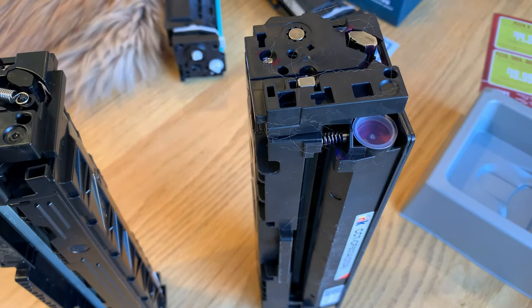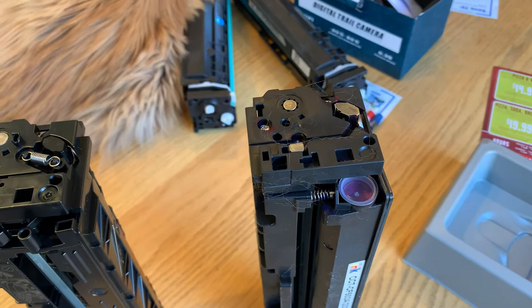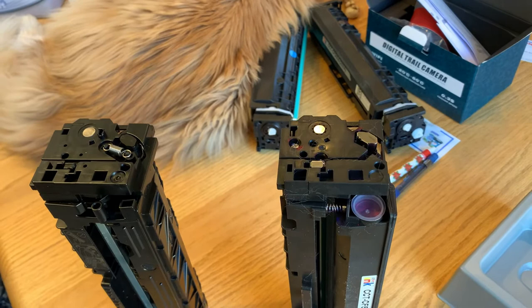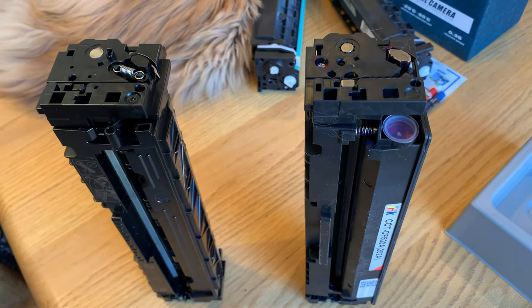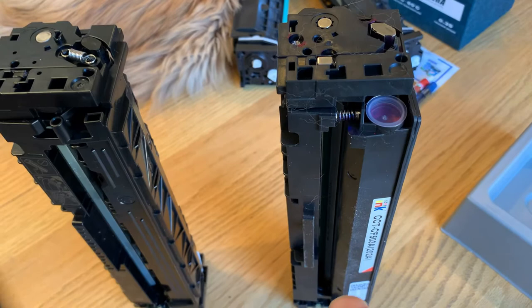It's the original way they used to make toner cartridges — they had a toner supply and a waste tank. The photo conducting drum picked up from a roller that was completely coated with toner, and most of that toner just got wasted. What I discovered after taking this apart is there is no waste tank. They just scrape the excess toner that doesn't get used for printing off, and it falls back into the supply bin. So you don't even need to worry about emptying a waste bin — if you're getting low on toner, you can just replenish it by taking the cap out, putting more toner in, and putting the whole thing back in the printer.